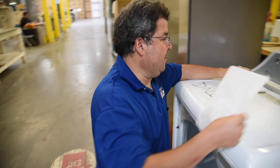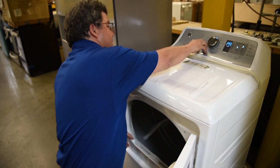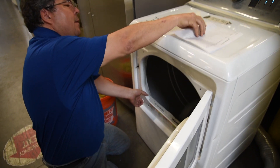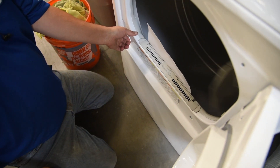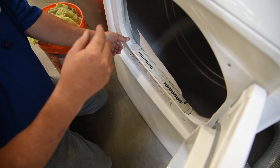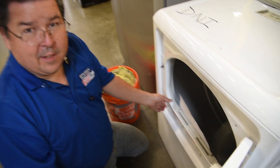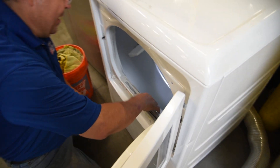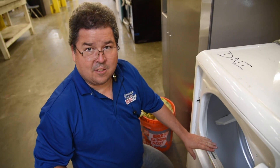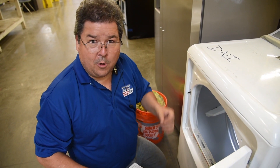Now when it's working properly, I will tell my door it's closed and I will hit start. When I put the piece of paper on there, if it's working properly, it's going to hold my piece of paper. That means my venting system in my dryer is working correctly. To show you that it's actually real and not fake, I'm going to stop it and the paper's going to fall. That's how you can tell if your dryer venting system issue is either in my dryer or in my house — which is causing my heater in my dryer not to heat correctly, which means my clothes are not drying properly.